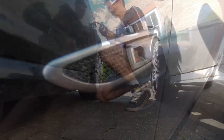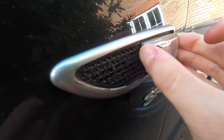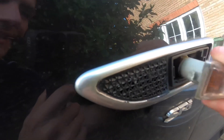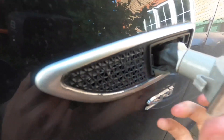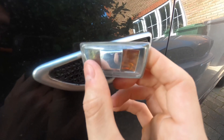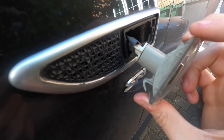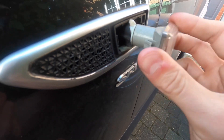On one side of the car I actually had to use a screwdriver to try and prise it out, but normally you need to slide it towards the back of the car, unhook that one side, then slide it towards the front of the car to get the entire assembly out. Here's a shot of the two clips you're looking out for, just so you know what you're looking for.